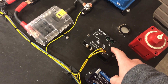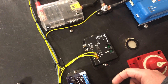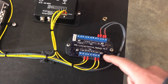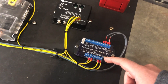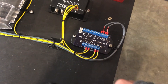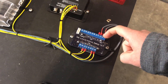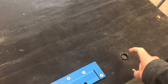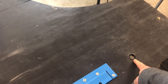This device communicates to the lithium batteries via these ports here where it takes M8 cables, and it sends a CD — charge disconnect — or an LD — load disconnect signal — to our proprietary V4 board, which is kind of the brains behind everything. It takes input from the VE bus BMS, which is the Victron communication device, and it has a temperature sensor which monitors the batteries to make sure they're not frozen. Then this is all outputs: alternator control, solar control, DC load control, and then two different relays. One of them we use to control the Victron MultiPlus inverter. This grommet is going to bring in the 10-3 cable, which is the main input breaker — the 10-3 cable from the shore power connection. It's going to come through there.